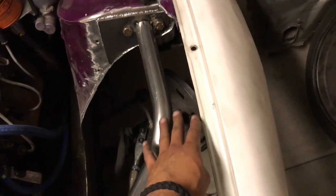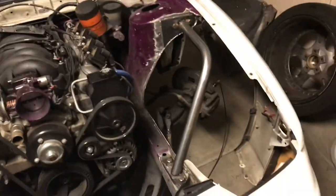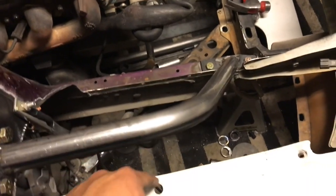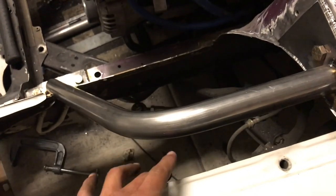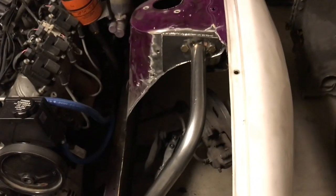I re-tacked that side like three times. But I have pretty much exactly where the bend starts from here — from the edge of the tube to the fender I have two inches and an eighth. And on the other side, exact same spot, I have two inches. I wanted to get it perfectly but you probably won't be able to see an eighth with your eyes. So now I'm going to take the fenders off, the front bumper, and then start on the U-bend.